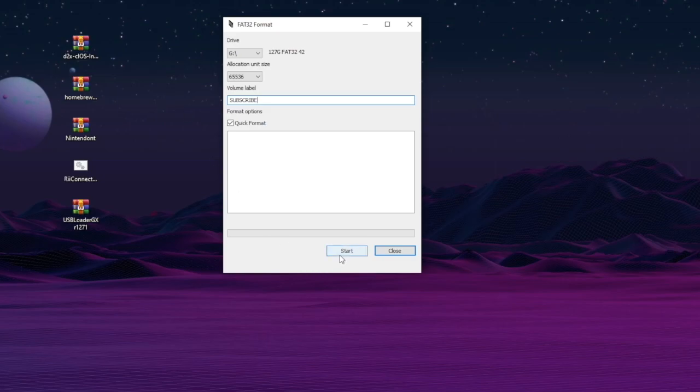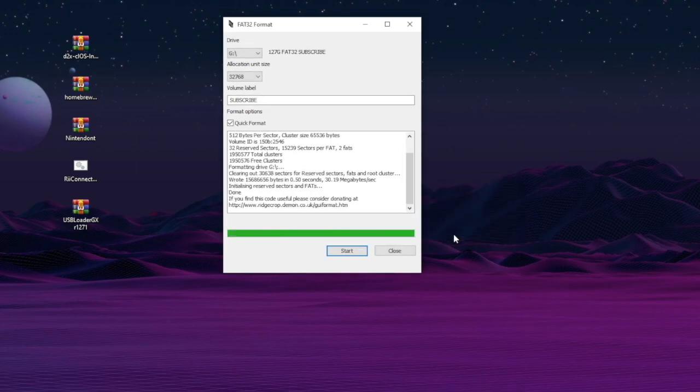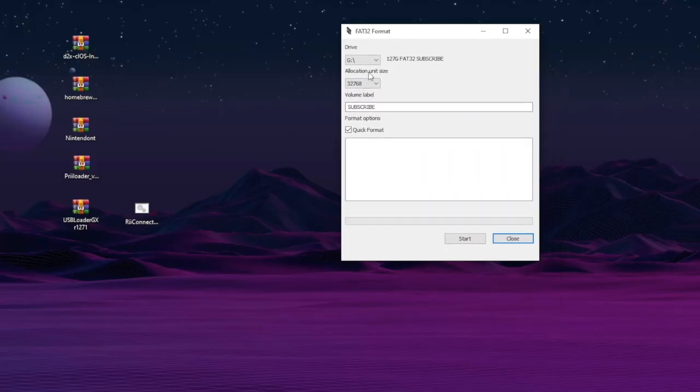If your SD card or USB drive is larger than 32 gigabytes, you will have to download GUIFormat, also linked in the description, in order to format it to FAT32. If your SD card or USB drive is 32 gigabytes or less, Windows will be able to format it without the need of another program. Along with this, you will also need an archive program such as 7-Zip or WinRAR.